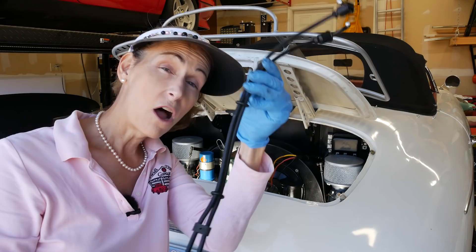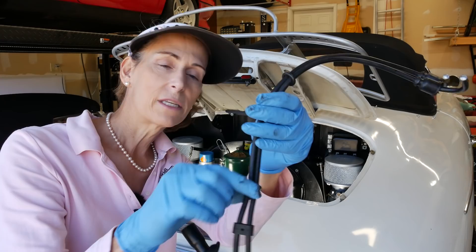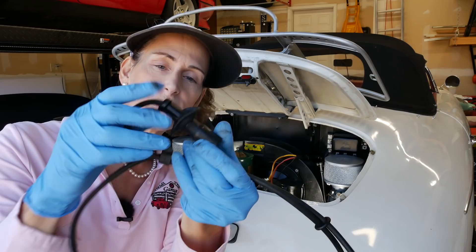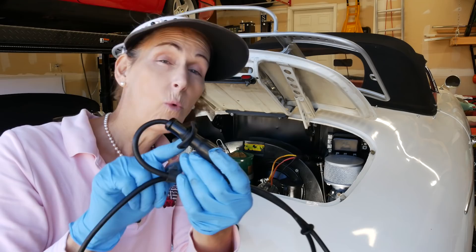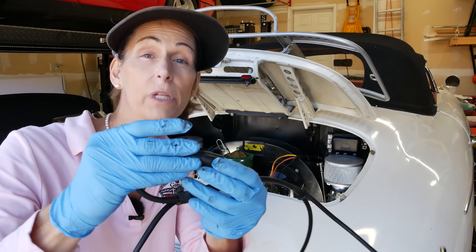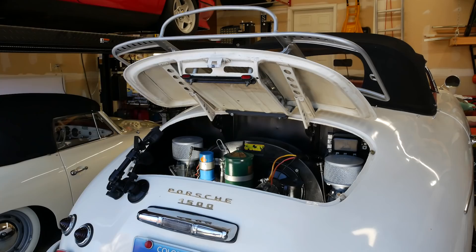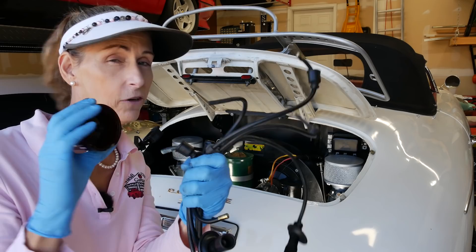This is the longer set for the right side — cylinders one and two. Notice there are little O-rings on here that just keep the wires together, so we have to refit those. Take a look at our rubber air caps — look how distorted that one is, all wanky. These really need to seal well over the holes in the tin, or you can get cooling issues. I'm also noticing this thing is pretty loose — look how easily it spins on the wire.